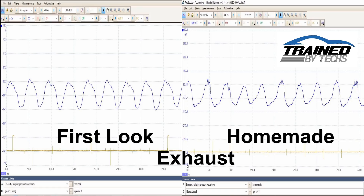We put the first look and the homemade sensor in the tailpipe of a Honda four-cylinder. Again, we're looking at nice, even pressure pulses. The exhaust pulse from every single cylinder is the same. We don't have a misfire. We don't have a valve timing issue. This car is a known good — it's running properly.